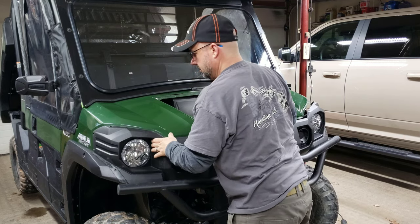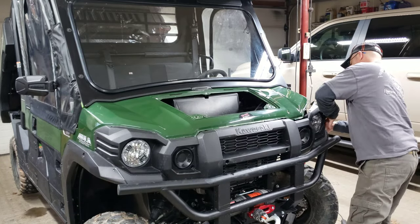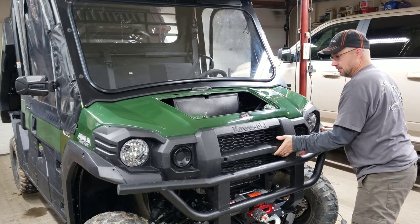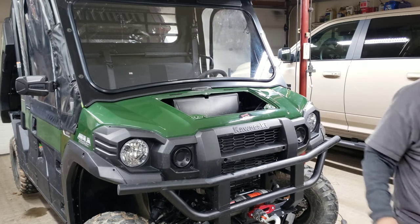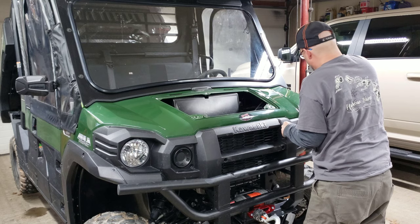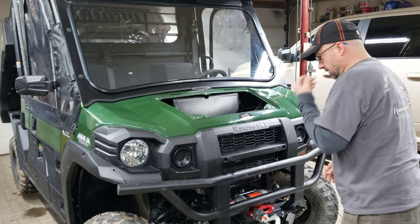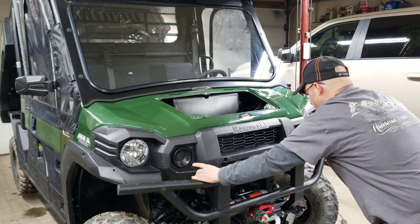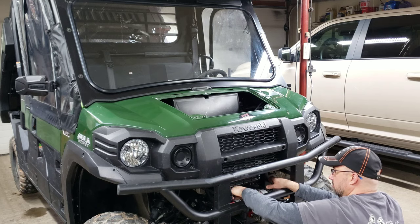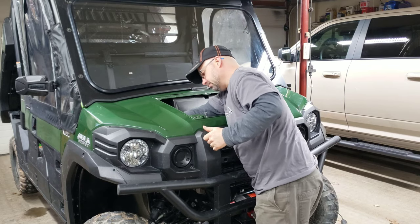Okay. So all you do is pull these out, put them around there. Top. Now you can just grab a couple of these black plasticky screw things, just throw one in your top right above your headlight here, just to hold everything back in tight where it needs to be. So now, like I said, you're going to have metal Phillips screws here, metal Phillips screws here, winch cabling, it's all through there now. So that's it. You gotta plug in the BeamTech headlights. That's right.